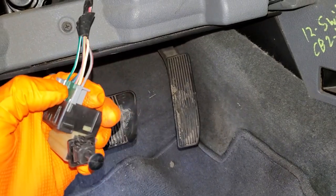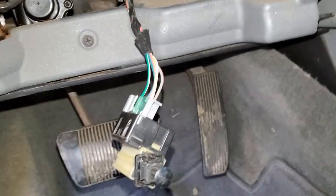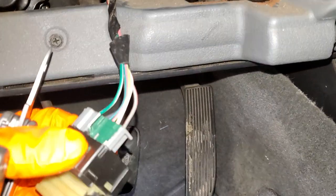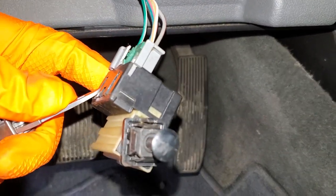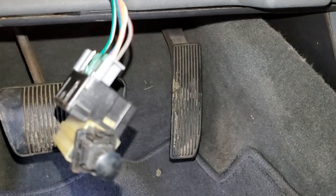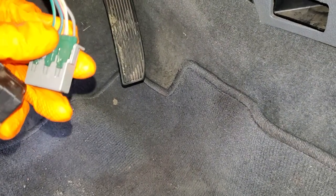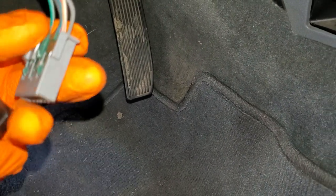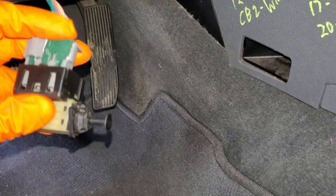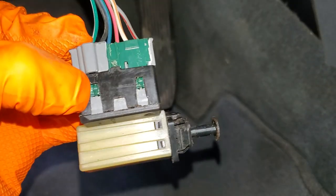You can see I kind of broke this connector — it's a little tricky to disconnect. Sometimes you can do it without breaking it, sometimes you just break it. That green piece is really what retains it — the green piece is part of the connector. I pry on either side where the little green tabs are; you want the green piece to come up and then the whole piece can come out. You can see I've got it disconnected, and the green piece kind of floats around. The little protrusions on the green piece are actually what holds the connector to the switch. When you hook up the new switch it just slides in, and you can see that it's fully connected when the green piece has the little nubs popping down.